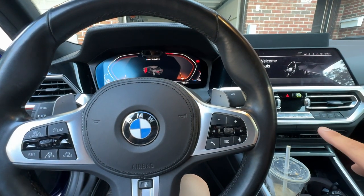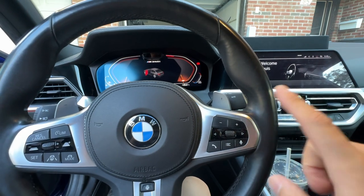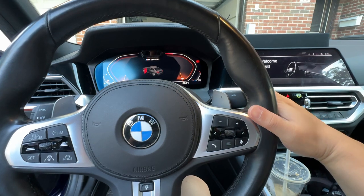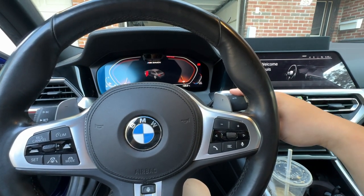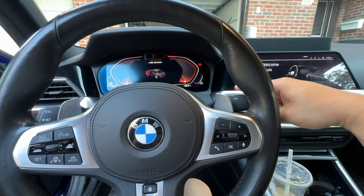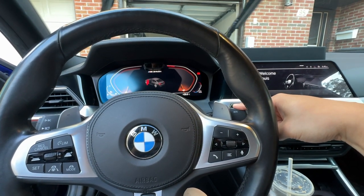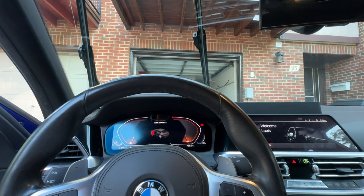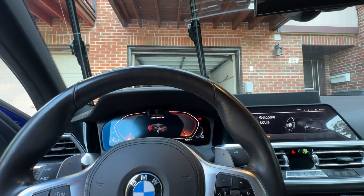To go into service mode, the car should not be on — it doesn't need to go into diagnostic mode, this is fine. Just open the door into the car, that's it. Go to your wiper stalk — the right one, and as far as I'm concerned it should be the same for left-hand or right-hand drive. Press down on it as far as it'll go and it'll sweep across, up until the point where it stays. It has now entered service mode.